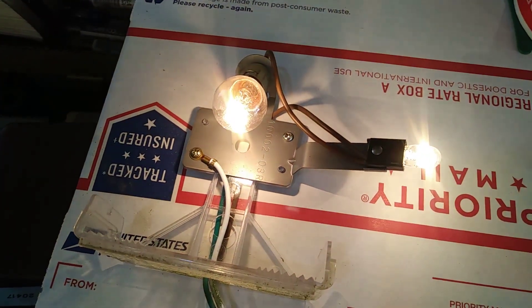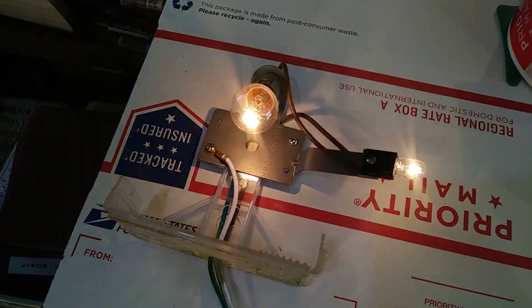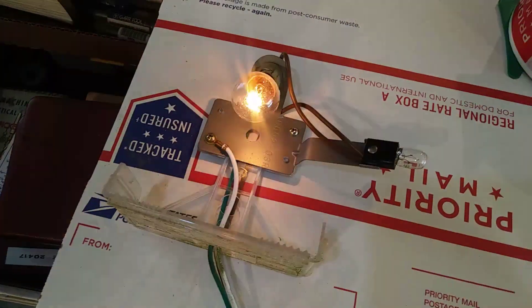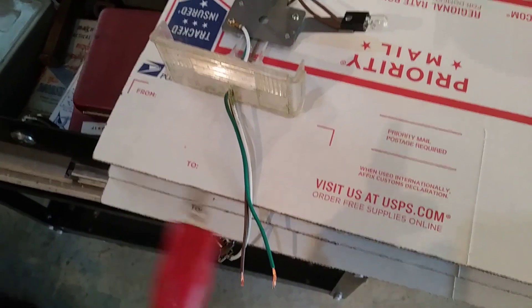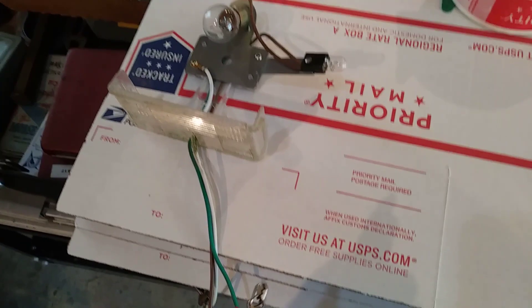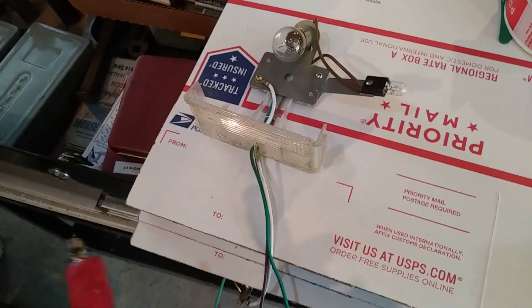We get a glow out of both of them. Now if I touch the green wire, you'll see the taillight get bright — there's low, that's the running light, that's the brake light. Considerably brighter. The green means this would be for the right-hand side. As you're facing the rear of the trailer, this light fixture should go on the right side. If it had a yellow wire, that would indicate it should go on the left.